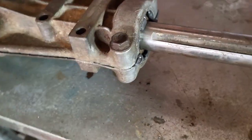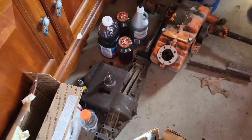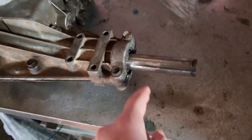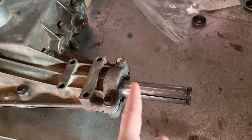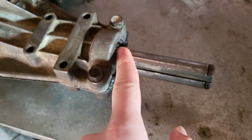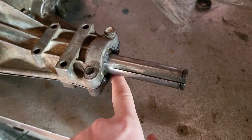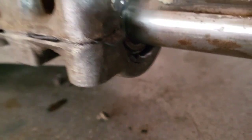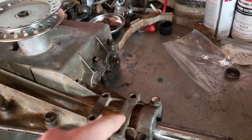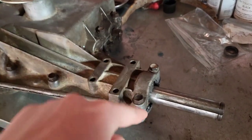Like I mentioned before, what I now do on my 820s: this one leaked a bunch of oil from those axle bearings. When you put sealant all around here you go up over the bearing, and everyone kept saying your bearing's bad, it's leaking from the axle. But realistically there was no oil coming from the axle — there was a puddle always forming at the bottom, underneath the bearing. What I realized is, when you put your silicone all the way around and go over the bearing, this gets sealed but underneath gets none. So now I lift these axles up and put silicone underneath, so when you put the bearing down it gets sealant under there.